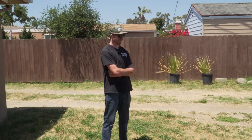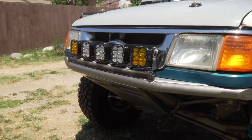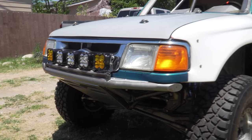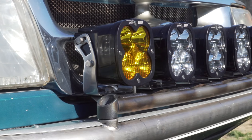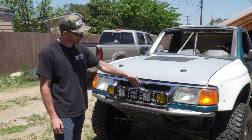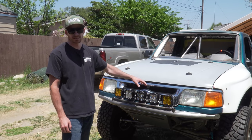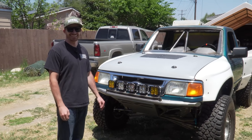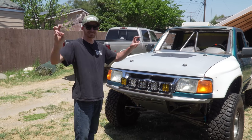The lights are here so we might as well just talk about them — this is the most recent thing. We weren't planning on doing lights on this first go-around, but we had a little bit of time because Jake was coming down. So Ryan decided he wanted to get some lights for the front of the truck and just get it done while the truck was here and everything's still raw. We did five XL80s on the front. The ambers on the outsides will be on their own switch, and the three lights on the inside are combos with spot and flood built in. The center one is actually a Racer Edition — it's a lower lumen output but throws light further. According to Ryan and everybody that knows Baja Designs, there are different light ranges and stages you can get, and Ryan's pumped that he has all five stages.